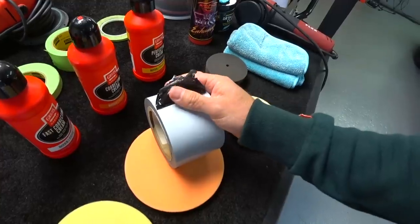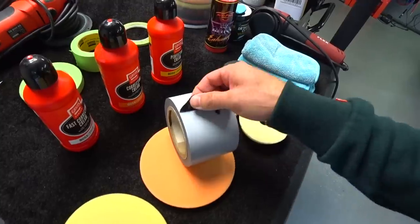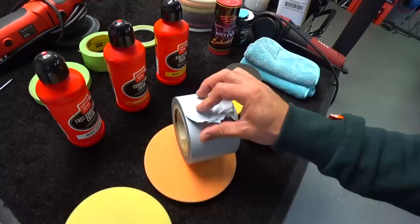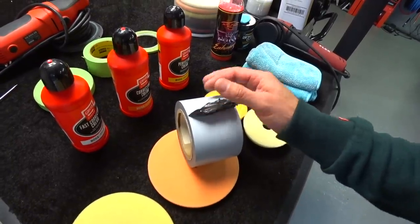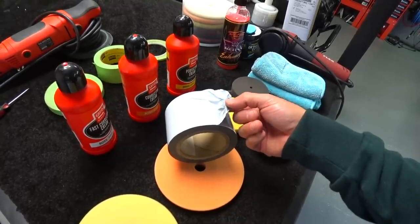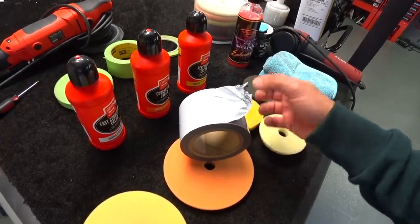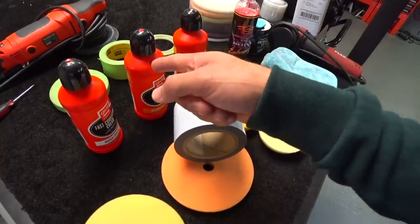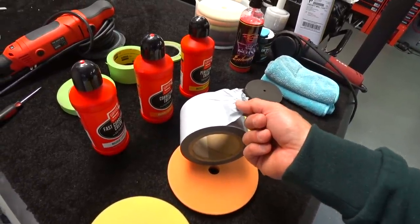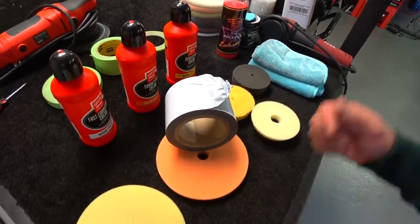This other stuff is protection tape. It does not have adhesive — it's the same material you see on new cars at the dealer lot, that white film. I get this by the case. We use it a lot when we protect cars, especially around door edges and when shipping cars on trailers. It will not lift paint, especially on specialty cars, repainted cars, or vintage cars. Sometimes masking tape will reactivate and cause paint to lift. This stuff is super safe. Sometimes I'll lay two layers and then put 3M tape over it for transport.